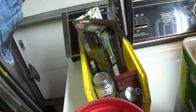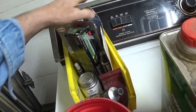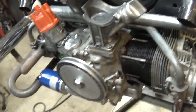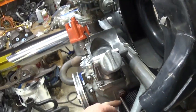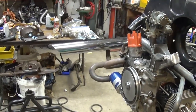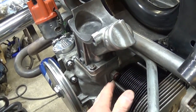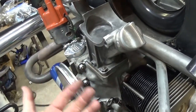Instant gasket sealer. This is like a small one that I would take with me when I go camping or go out of town. A lot of them will say metal or aluminum, steel, that type of thing. I used the Gasket Cinch, that Permatex aviation sealer, on some of these head bolts. On one side I use the aviation cement on the head bolts. On the other side I use the 518, and on all 4 cylinders I use that Ultra Black.